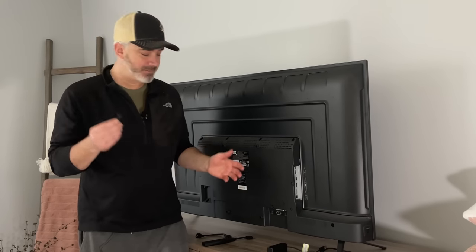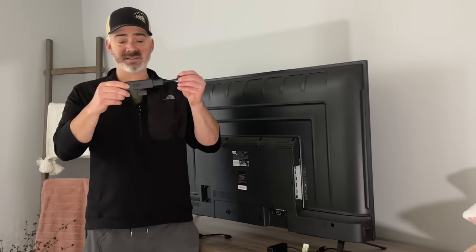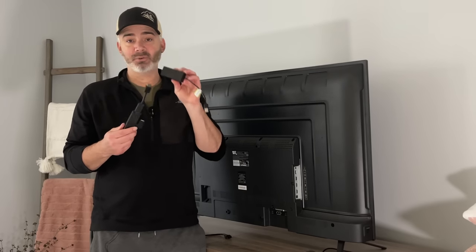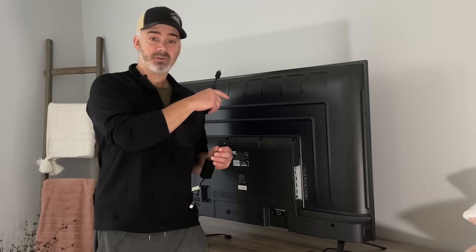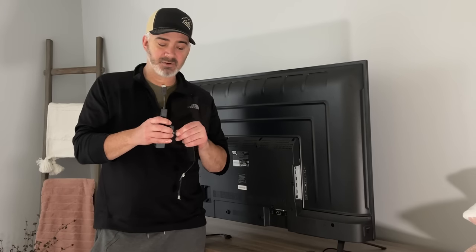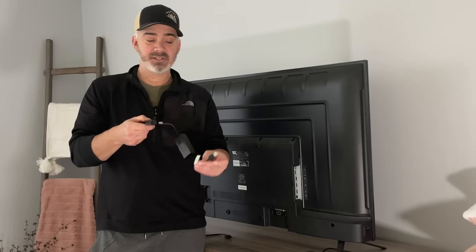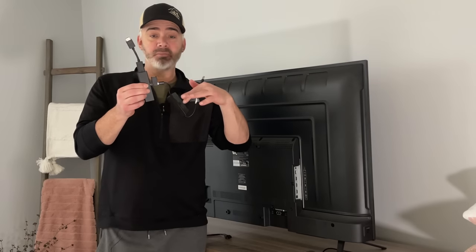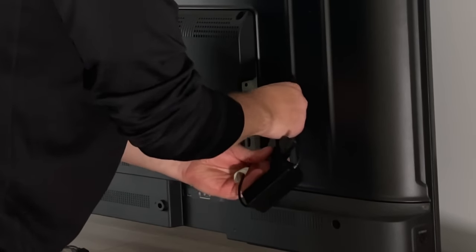What you're going to need is an OTG adapter — no matter what, you need one. There are two kinds: a little L-shaped one, or a cord. If you use thumb drives, use the cord because many are too thick for the L-shape due to spacing. If you use a two-terabyte hard drive like I'm using here, you can use the little L, which means fewer cords. Remove the power cord and plug the OTG adapter right into your Fire TV stick. Then add the Mission powered USB cord — this is very important for the setup process. Don't plug your drive in yet.